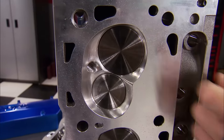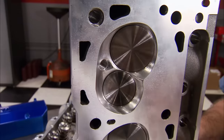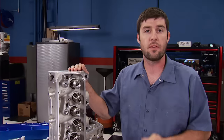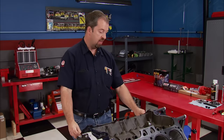Valve sizes are 2.200 on the intake and 1.760 on the exhaust. The combustion chamber is CNC machined and comes in at 78cc. The valve springs will work with our custom solid roller already, so we don't even need to change them. 27-thousandths compressed thickness cometic gaskets will put our compression ratio right on target at 10:1. That's a great setup for street-friendly pump gas and allows a big hit of nitrous when duty calls on the drag strip.